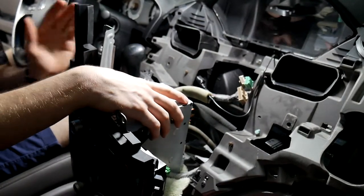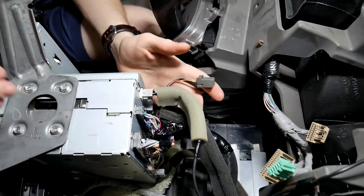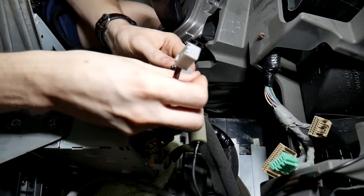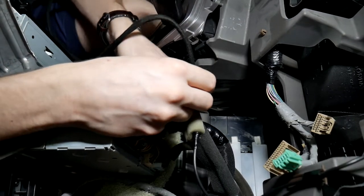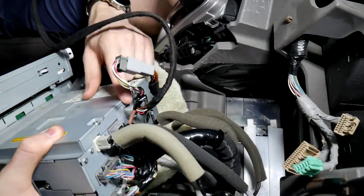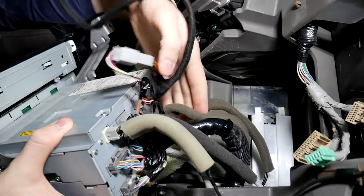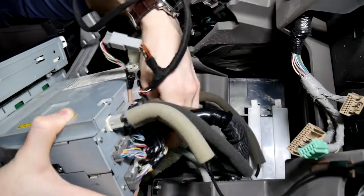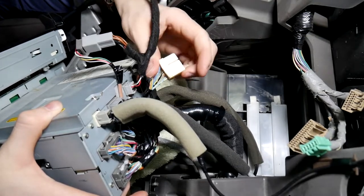We've got the radio out and sideways so we're just going to start making our connections. The first connection is right here — that's an eight-pin connector for the video. This is for the Honda Odyssey or any of the Honda minivan model lines; they're going to have this eight-pin connector, whereas other Hondas will have different ones — normally a 16-pin. So we're going to plug that in here on the top middle of this radio. Next is towards the bottom, in the same area but on the bottom, and we're going to unplug it. The biggest thing when unplugging these is not to pull on the wires themselves but to wiggle the plug.